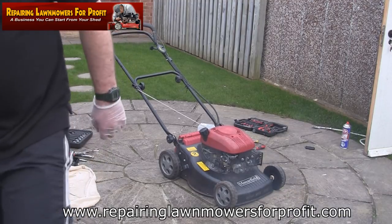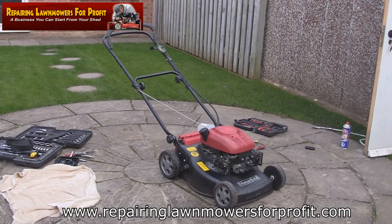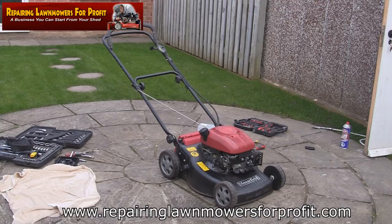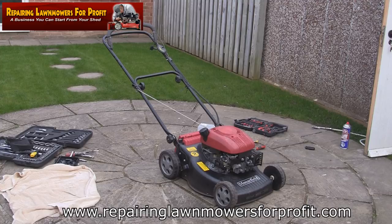We've got it going! There's quite a lot of smoke coming off that. If you look back to previous videos, you'll find that when a mower's been tipped up, the oil goes the wrong way. All that is — the oil's gone into the exhaust outlet. I put it on choke and it started up well. The throttle never works well on this, but it ran perfectly on full. All you need to do now is run it for a few minutes and burn off this excess smoke — I'll do that now and re-film it once it's all gone.